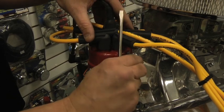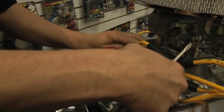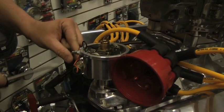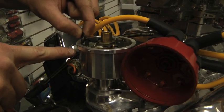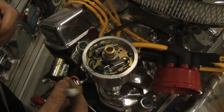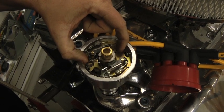The first step is to remove our cap and rotor. When exposing the inside of your distributor you'll see a rotor which can be pulled off. Next we're going to remove the condenser, and then remove the plastic insulator which houses the power wires going to both sets of your points. Now we'll remove the two screws which will allow us to take the inner plate out of the distributor.